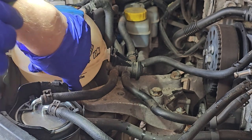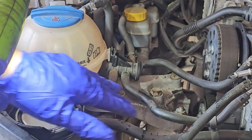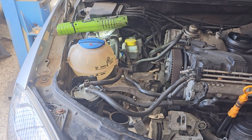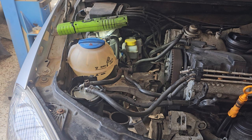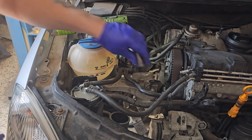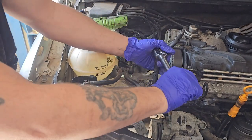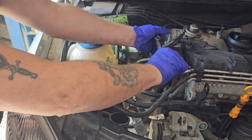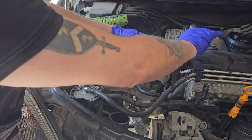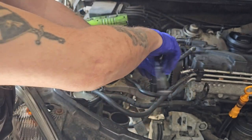So we've got a bolt just down there, or a nut there, a bolt there, a bolt there. We can get this top part off it, and then there's another bit to take off after that, but let's get this top part off first. What do you reckon, 16s again? It's not going to be that one because that's not a 16. Looks good. Just undo them a little bit at a time. Make sure the weight of the engine is supported. As you can see now, they're coming out quite nice.